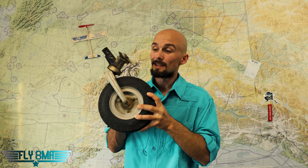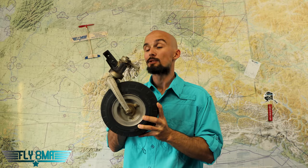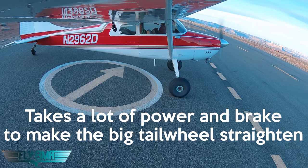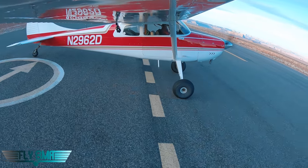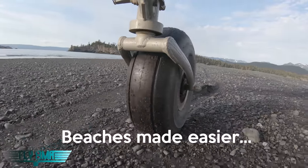The last thing to mention about big tail wheels: keep in mind bigger tail wheels are a lot more prone to shimmy than little tail wheels — from all manufacturers. The more tire you put back there, the more likely it is to shimmy, and there are things you can do to reduce that but only to an extent. Smaller tail wheels tend not to shimmy as much and they typically turn a little bit easier for taxiing, especially on harder surfaces. On softer surfaces the big tail wheel is great. Be realistic about how soft the surfaces are, and be realistic about your own skill and whether you can lighten that tail when taxiing, or if you need to default to a bigger tail wheel like we did.